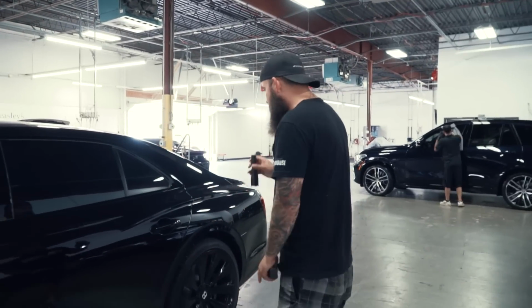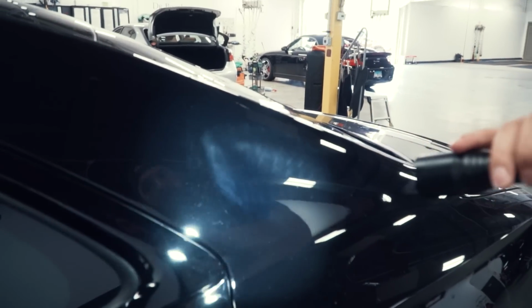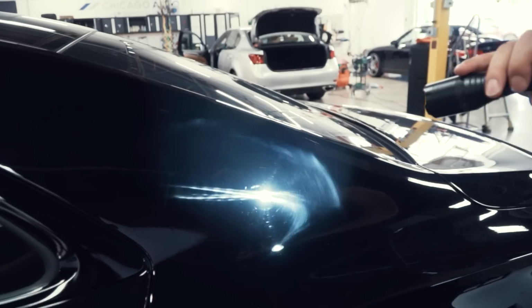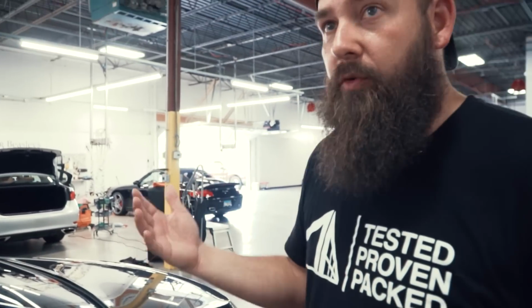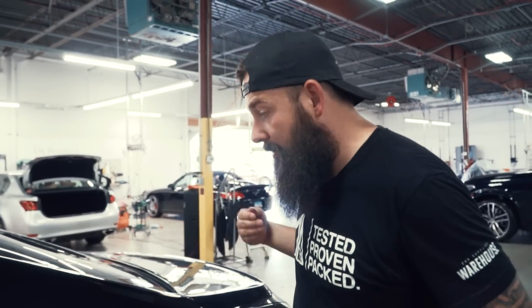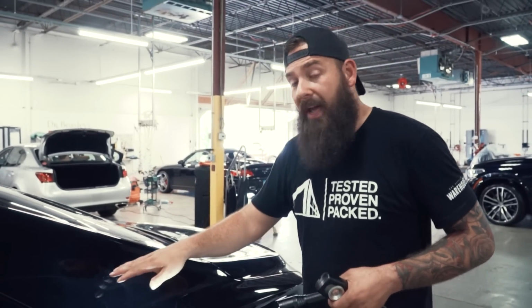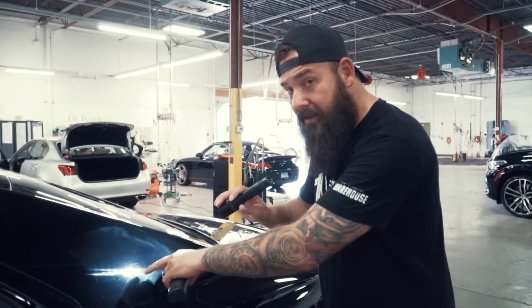So looking at this Bentley, the first thing that we see, we saw this again on the Tesla, you see this haziness here. That's somebody polishing out something for some reason. And if you look right in the middle, you see this big old scratch. So whether that was the dealership, because these cars get delivered a lot of times on open trailers, maybe something happened when it was being pulled off the trailer. It got scratched right here, so the dealer may have wet sanded that area and then polished it out, as you can see. But that scratch is pretty deep.